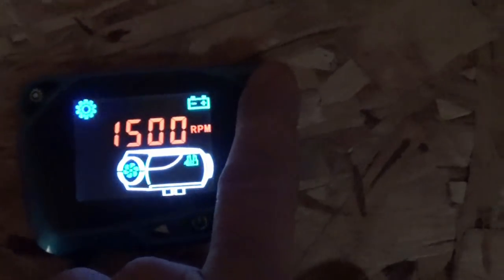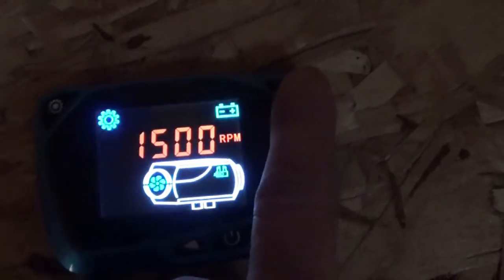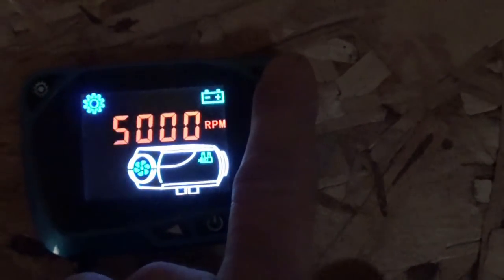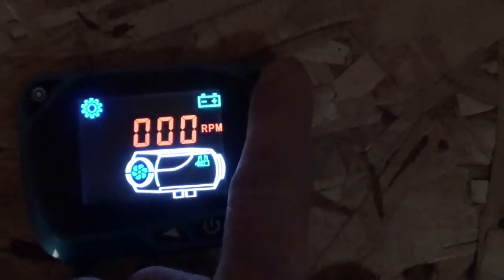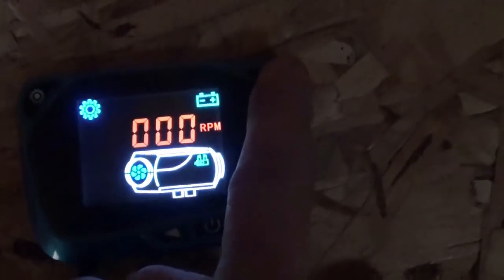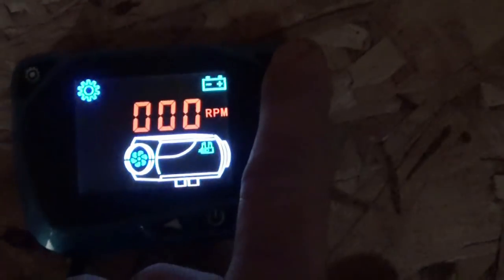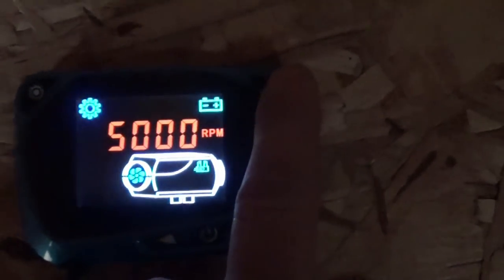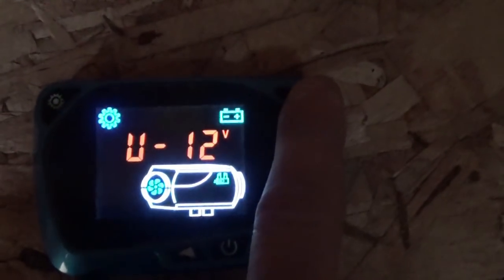Maximum 4.4 times a second. Yeah, if I go more than that, the thing overheats. Minimum fan speed is the minimum fan speed. It does math, it regulates it. I can set the stuff minimum, it's fine. It balances fan speed with fuel when it's doing it. Maximum, set it to the very maximum, because you want to run lean so you don't carbon soot up all your stuff. So more air is good, just you can't overdo the maximum air.